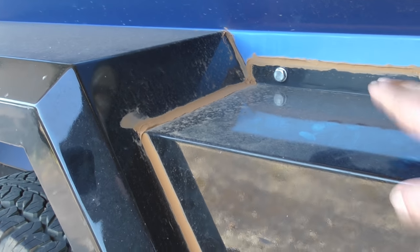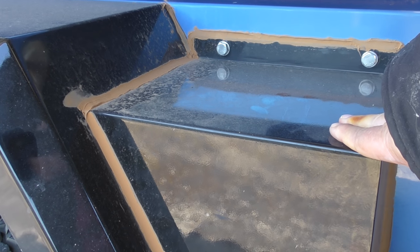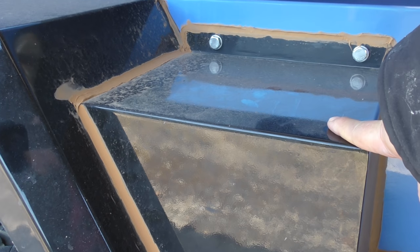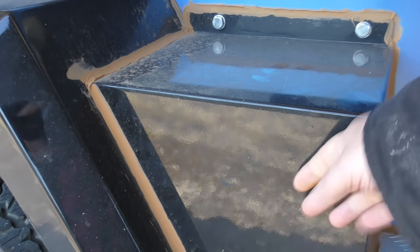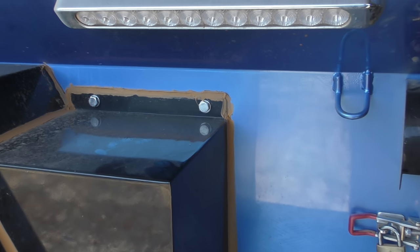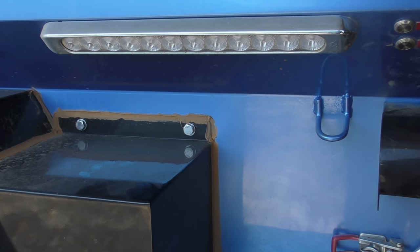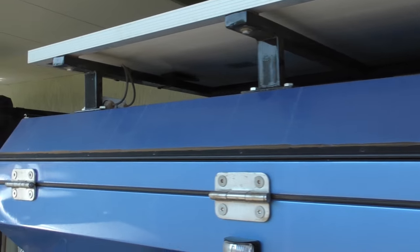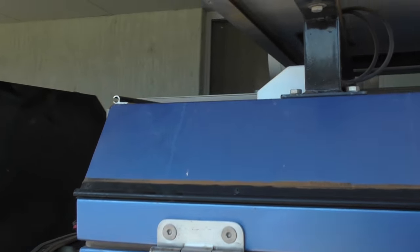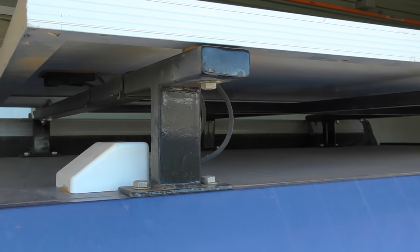There's the offending spot — that's where the water pump is. As you can see, it's really sealed up now. It has got a SureFlow marine sealed water pump in it, so even if dust does get into this little box somehow, the water pump's still going to pump water — it's not going to suck dust in anywhere. To get the solar through the roof, I've used a proper heavy-duty mounting and run the wires through, so everything's waterproof.